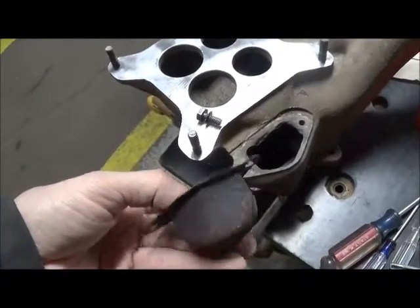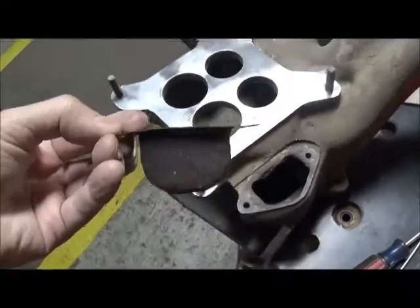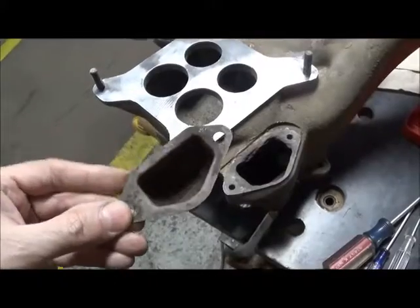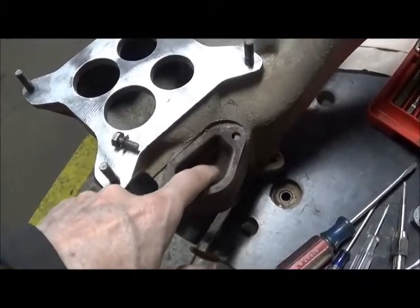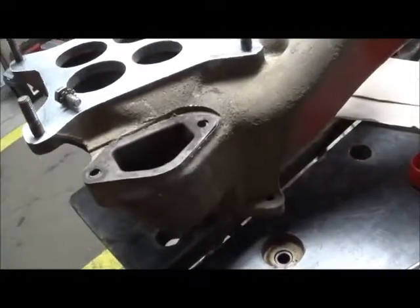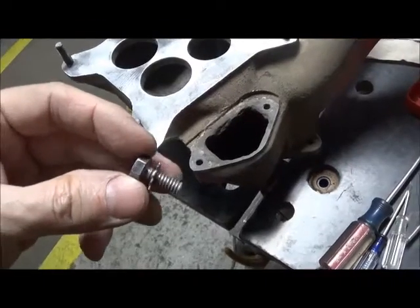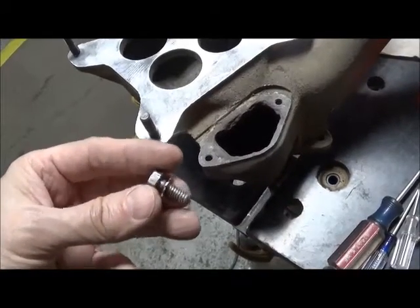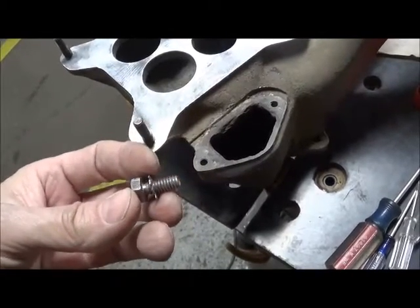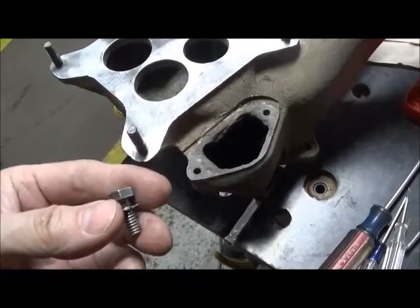This is the choke pot — it actually fits into the well. The exhaust heat comes up from the bottom and bathes this cup, so these things can corrode through. In this cup sits your thermostatic choke coil, and that's how you get your choke operation. So when everything's happy and healthy it'll just fit right in there. This screw is a 1/4-20, fits on a 7/16 wrench. You've got to be very careful taking it out because these don't have a lot of strength and you can break them.